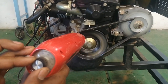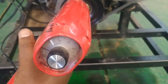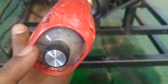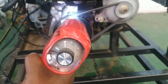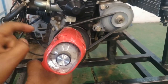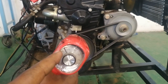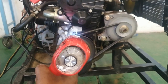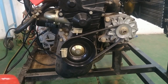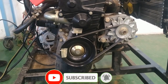The degree can be read by this knob. Now it is on zero — we want to see the amount of degree advanced. You can turn with this knob and see how much degree it is advancing. Now let's see how much degree it has advanced. If I want to read how much degree it is advancing, I will turn with this knob until the marks align — and you can see it is 15 degrees advanced. Well viewers, that was all. Thank you for watching. Please stay tuned if you'd like to see more videos of this kind. This is a dynamic ignition timing test video.